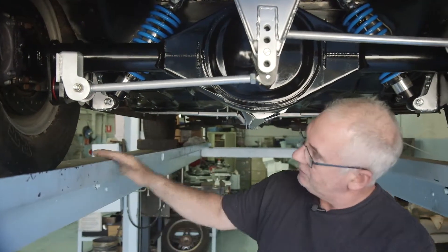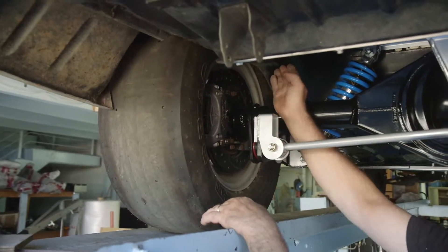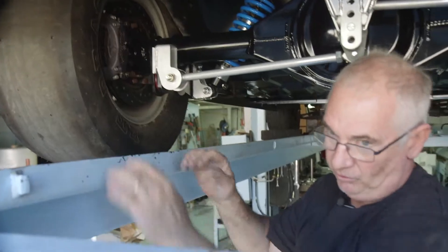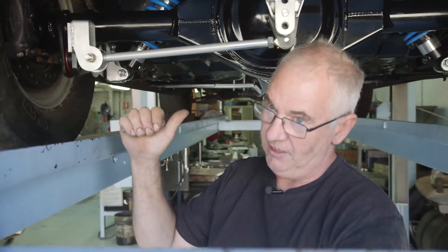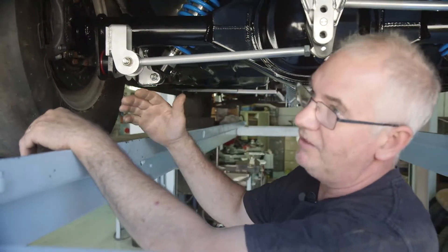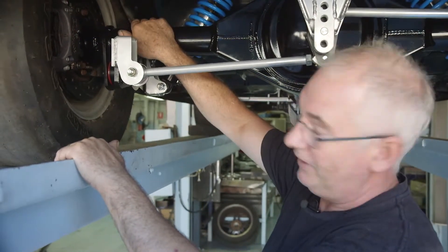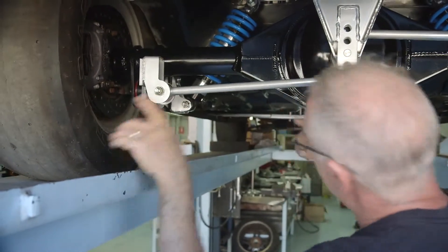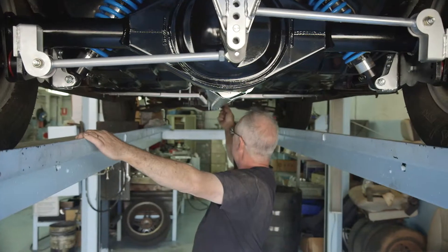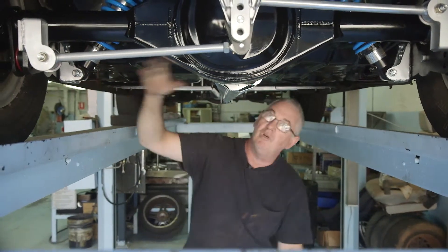Added to all of this are the major handling benefits. First, over the leaf springs, it eliminates roll understeer. An original leaf spring when it compresses moves the axle housing forward, so if one side is compressed and the other is relaxed the axle housing skews in the car — this turns the car out of the corner, and when you straighten up it releases and oversteers. Some triangulated rear ends actually have more roll understeer than the standard leaf springs, but this suspension configuration has zero roll understeer. Additionally, the torque circuit — instead of going through the leaf spring into the chassis back to the engine mounts — now transfers through the torque arm into the front cross member, a shorter distance to the engine mounts, making the back half of the chassis a push motion rather than a twisting motion.